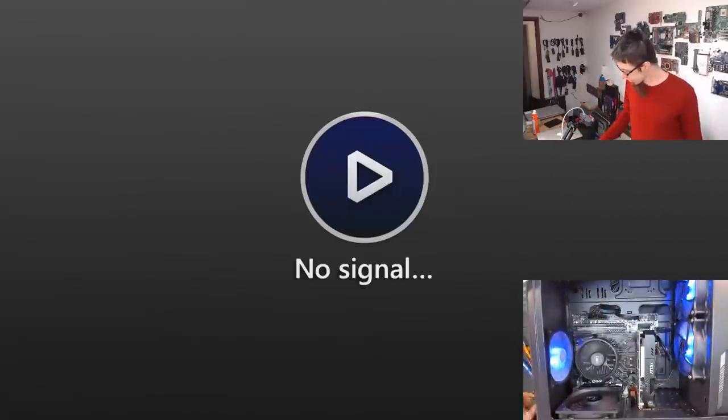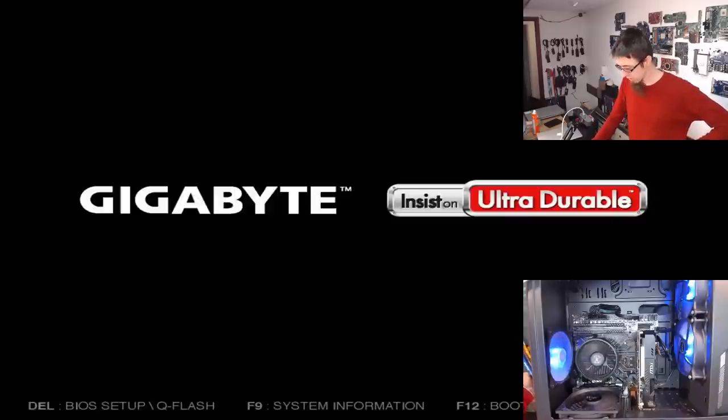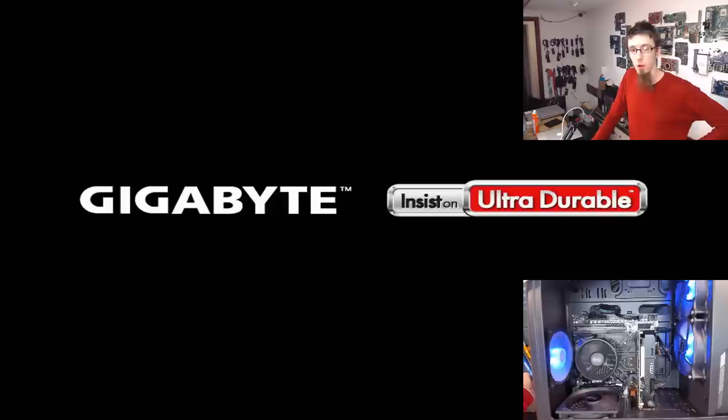Again, this is a long shot. However, XMP can sometimes cause problems, so we're going to switch that off. If it was an XMP issue, I would expect blue screen errors. And in fact, even if we had faulty memory, I would expect blue screen errors.